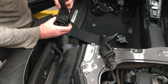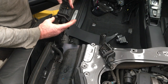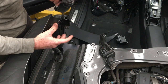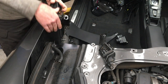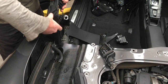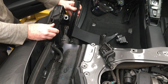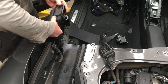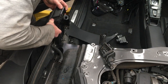Once that comes out this thing can get pulled out - be a little bit careful as it's a fairly convoluted piece of rubber. For installing, make sure you have a good look at where everything goes. When putting it down you'll have a little bit of room at the back to feed your hand down there and put it into the slot. Then at the front, make sure you have the seal here removed - that's easy to feed back up later. Feed it in there and it might take a little bit of practice to get it into the right position.